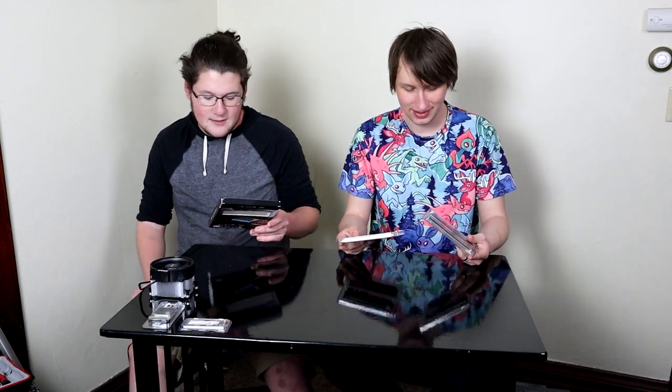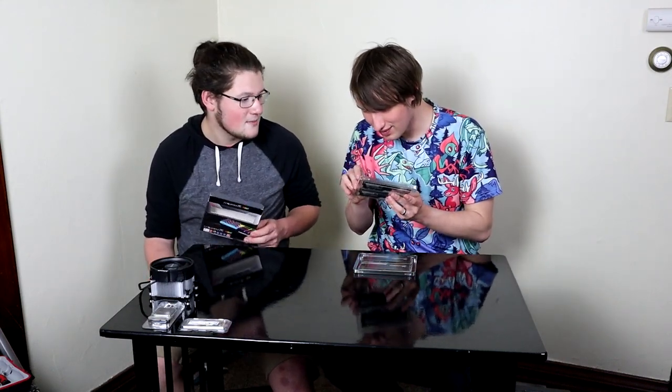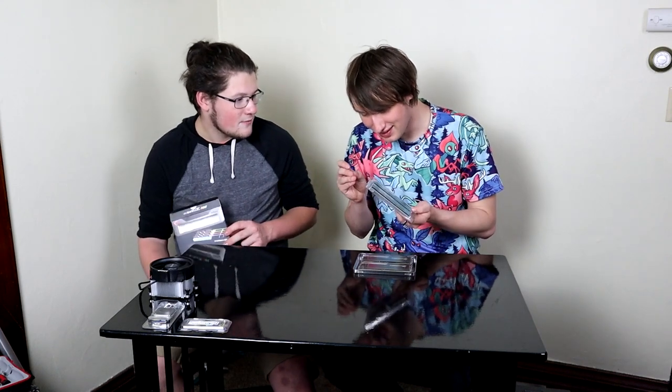So, the RAM is basically the part that keeps all of your running programs up and running. And he made me buy some really nice ones. These are Trident Z RGB, 3600 megahertz, because you generally want a really fast speed for the Ryzen series of processors, because they are, unfortunately, memory hogs. And we have some broken vacuum form packaging. The plastic, like, shattered at some point. I hope that doesn't affect anything. Nah, it should be fine.